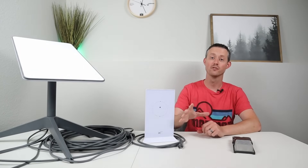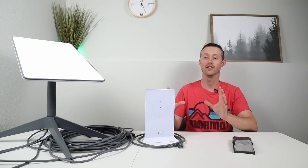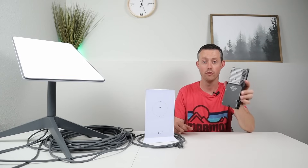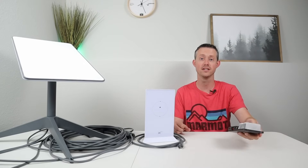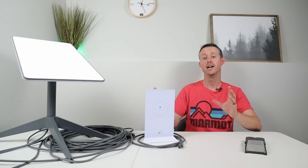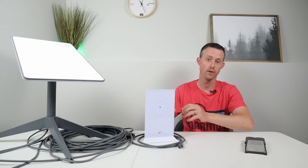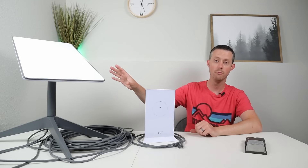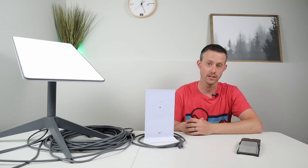In the past, as I've been searching on YouTube for 12 volt conversions for Starlink, there are clickbait videos out there that are super convoluted and complex. So it's super nice to have a plug and play 12 or 24 volt conversion for your Starlink. I appreciate X-Star sending this out for testing. We also tested with the Starlink app — it seems that the app connects to the satellite receiver itself, so you do not have to have the Wi-Fi router in place for the app to work. We were able to angle it properly, put it in stow mode, and check out the snowmelt feature. So everything still works when you're using the DC conversion.